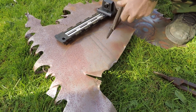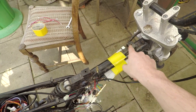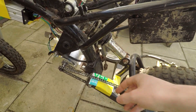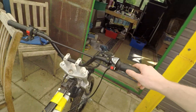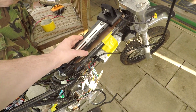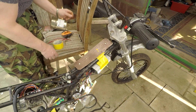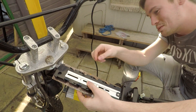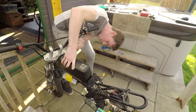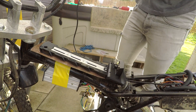I'll cut this and mount it to the bottom of the frame, then mount this to the plate. The bit dad's currently cutting is going to make this bit of the frame connect to the battery so it's securely held on. The bit down here I've just done is a chain guard that stops the chain getting caught in a little crack down there. We've mounted up the throttle up here — I'm excited to see how it goes. That'll be how it goes — let's stop it falling off. The original try was just to bungee it onto the frame, which went about as well as you'd expect. Dad's left me with the fiddly job of putting these on — it lays flat and then pushes along, so if you can't lay it flat you've got to move the whole thing back.